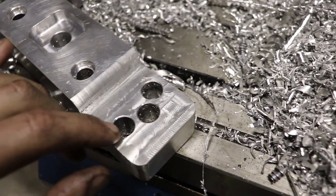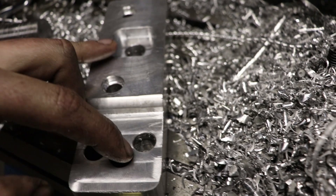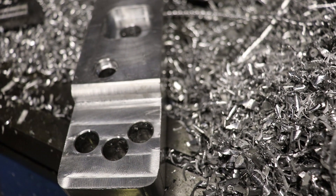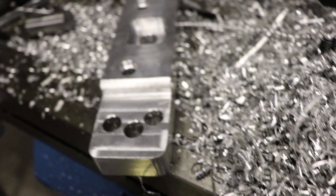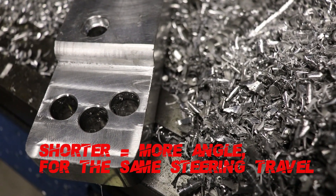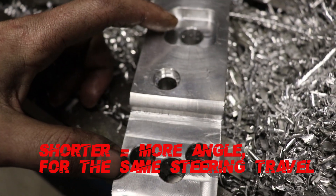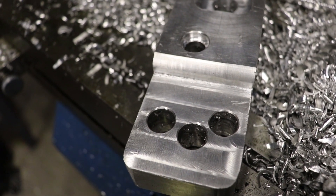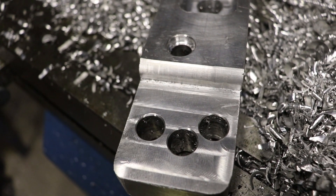These two are kind of like a wild card entry. That one's an 85mm center to center, which is like a good 40mm shorter than the standard center to center of the tie rod pickup point to the ball joint, and that one's got much less angle on the trailing wheel. And over here we've got like a 90mm pickup, which is also pretty short, and again on the trailing wheel.